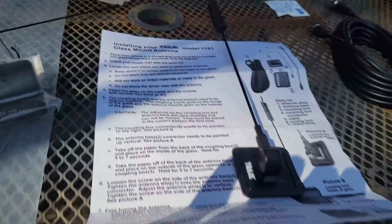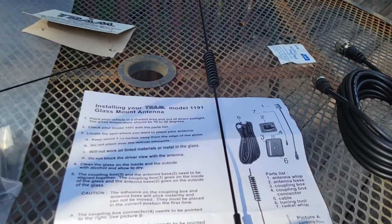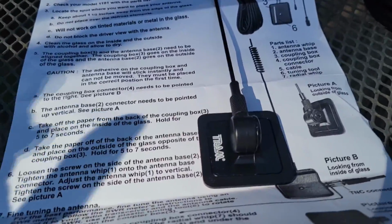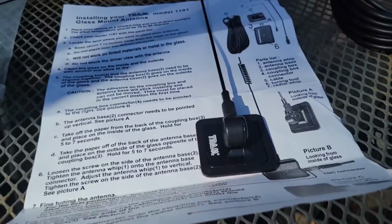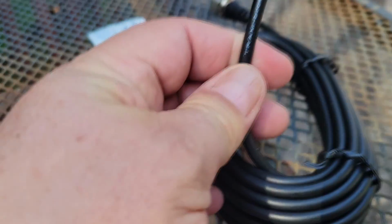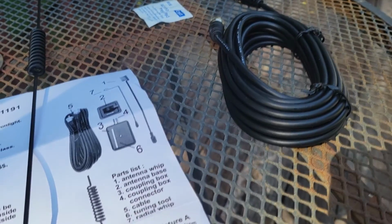So listen, I'm going to put a couple ham radios in my car and my wife's car. I've got regular ham antennas. The best are the ones that you have to drill a hole through the roof, the trunk, whatever. Then you've got magnet mounts, which can scratch. Then you've got trunklip mounts, which kind of scratch. And then you have the issue that if you don't have a thin enough coax, it can pull water into your trunk. So on a trunklip mount, they've got ones with a real thin wire that goes into a larger wire. Those are the best. They work pretty good.